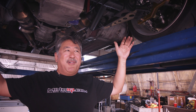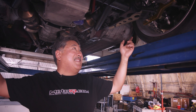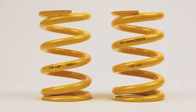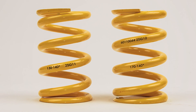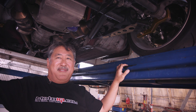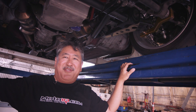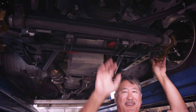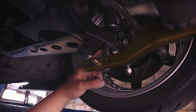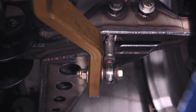Because we lengthened the control arms and have way bigger tires, everything has moved outboard to increase the track width, which has really increased the amount of leverage on the shocks. So we had to call our partners at KW and go to much stiffer springs and revalve the shocks for more damping — we're putting approximately 40% more load on the shock. Some of that load is due to the increase in motion ratio, and some is because we're running a really big sticky tire generating more G loads and forces. This car also has a trick Speedway Engineering sway bar with an unusual mounting — it goes through the control arm and mounts from the other side, so everything is slotted and relieved to allow full adjustment of the sway bar.